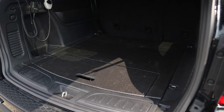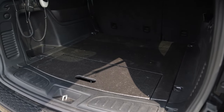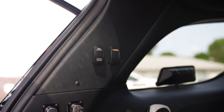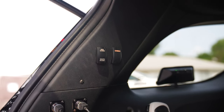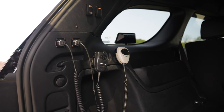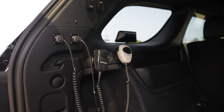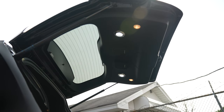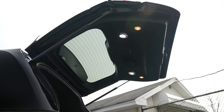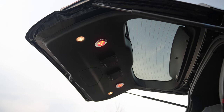With the hatch up we have the replacement floor mounting system with the electronics underneath it. They don't have any radios in the back but they do have remote mic kits, so they've got the mics on the side with the mag mics. They have the scene function between the two toggles, which brings you up top where there are Observe lights from SoundOff Signal in a red and white combination, and then we have the speakers for those rear radios mounted in the back.